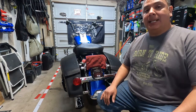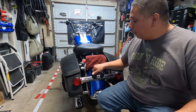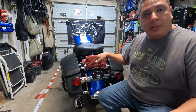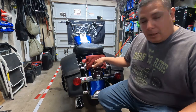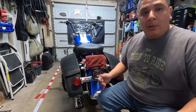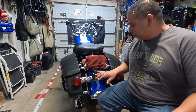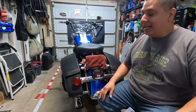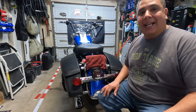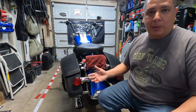That installation really doesn't get any easier. The one slightly tricky part — and I use 'tricky' very loosely — is when fitting it into the chrome trim on the fender, make sure you tuck the weather stripping under the lip first, then angle it in and plop it down. I put blue Loctite on the screws since I've had screws come out on my Evo softail before. Other than that: two screws, the connector, two pins — done.